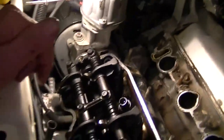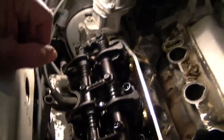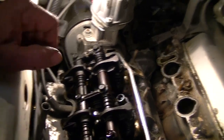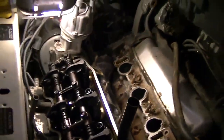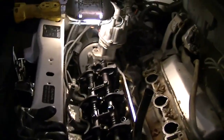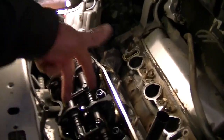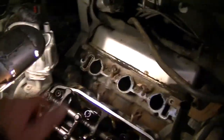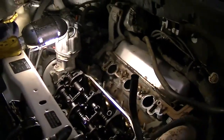They sit up in here and you can see — my fingers — probably about a half inch or so in diameter where that angles on that rocker arm. That's all bigger they are, they're pretty small. I think what's happened is the bores wore out of those lifters and they're just not holding hydraulic pressure. But when it warms up, it starts to run better and the tick goes away. I'm just going to replace those while this is all off. I can get all 12 — there's 2 per cylinder — 12 for about 50 bucks free shipping, and a couple of gaskets probably for another $10. It'll be a great deal.